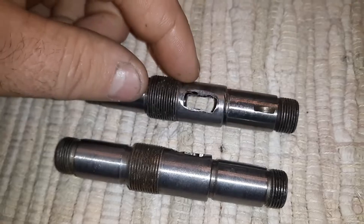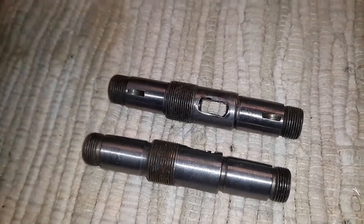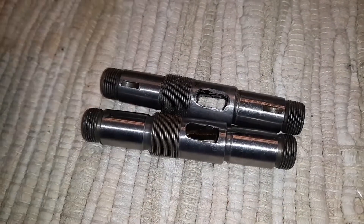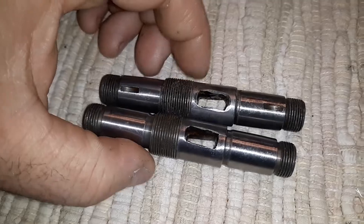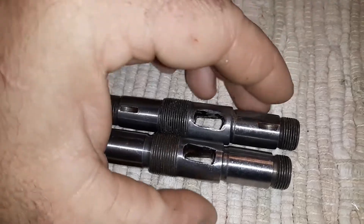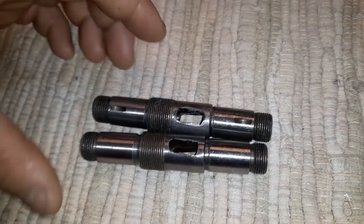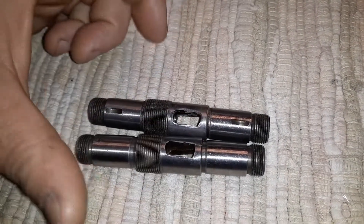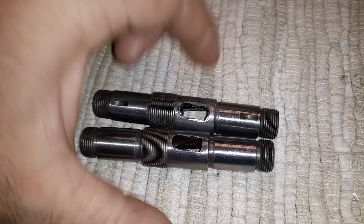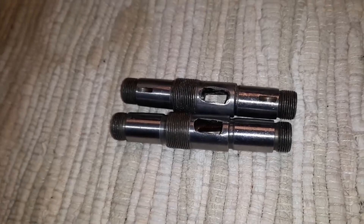The other thing is when you use the big spring and load it up, it is a beast to pull the clutch in and out with your hand. I like the three springs because it evenly distributes the force, provided the plates cut pretty well — that's basically the biggest thing. Those plates are often formed really badly. You'll see one with two flat edges — that's usually one they rolled. If you see one that's perfectly round, that's usually one that was stamped. They do two different processes, and the rolled ones wobble.